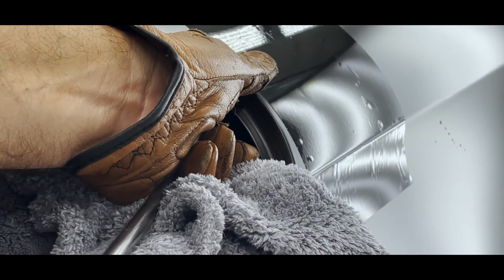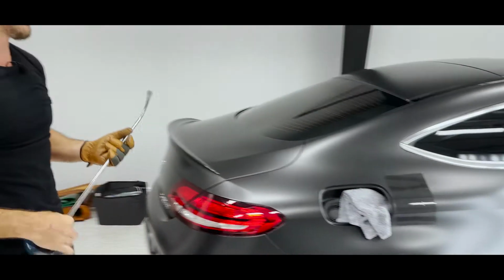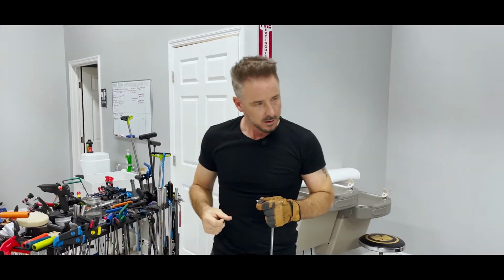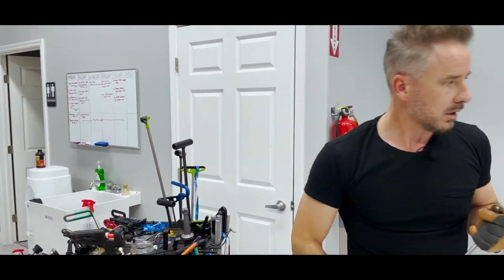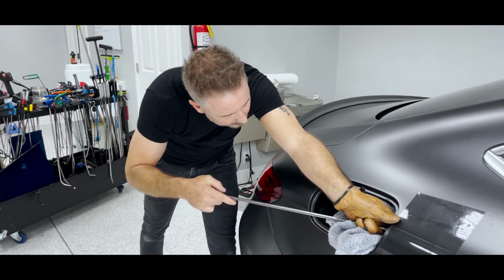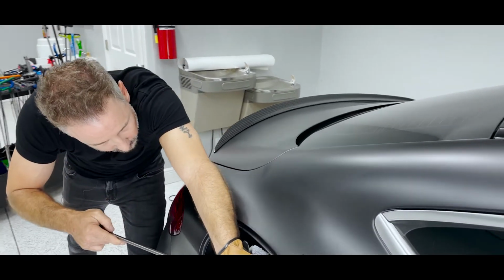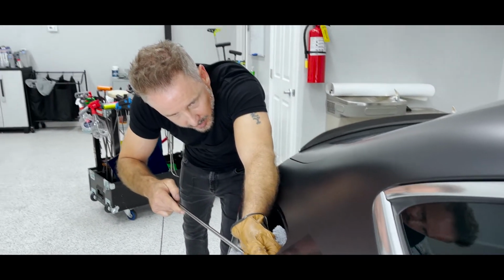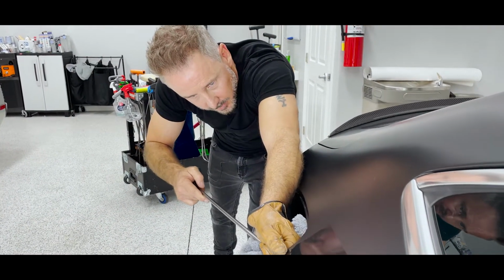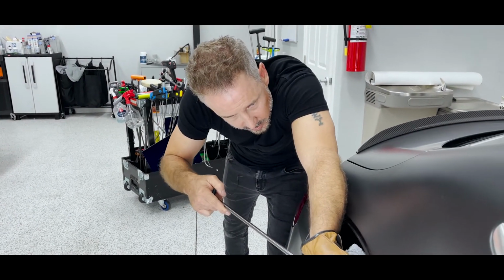When I'm watching, a lot of people think paintless dent repair is really super easy. It's micro movements and the tiniest microscopic little pieces that shape and make up the bottom of this dent right now. Now that I've gone metal directly to the back of metal, I can actually start to work out the center. I've kind of shut down the inner center a little bit by bringing up the depth with a tool that had a little bit of that rubber cap on there. Now I'm really already going into kind of finishing fine-tune mode.